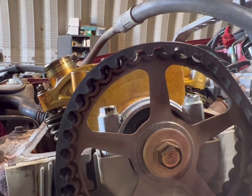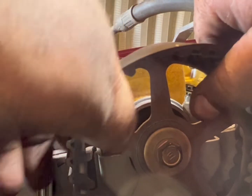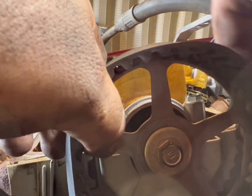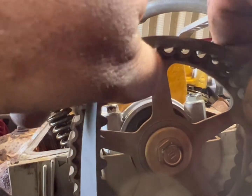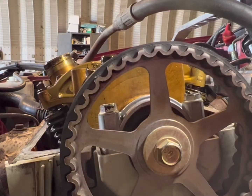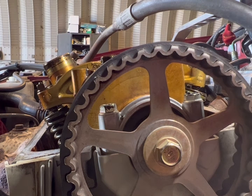Sorry about the camera, guys. I'm just trying to get this so you can at least see the belt going on. If this is on — see, that's right there — it'll just slide right on. It might take a little bit since it's a new belt, not stretched out. If you can't get it, go back and look at everything, make sure you have everything where it's supposed to be. There you go — belt's on. That's set.